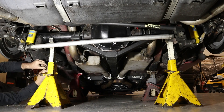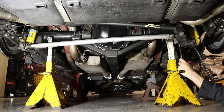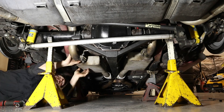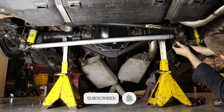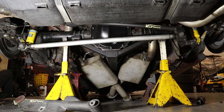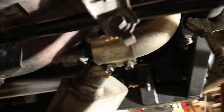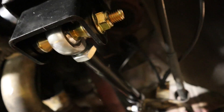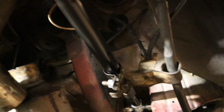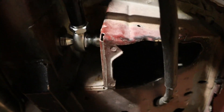I'll start by removing the lower control arms. I will lose the factory sway bar attachment points, but I've been running without a rear sway bar recently anyway and the factory location is just not good. If I need a sway bar going forward, I'll look into the Maximum Motorsports adjustable unit. Installation of the new arms is simple, but getting the new mount at the right angle took a lot of measurements and adjusting. I did need to use quite a few different shims to get the right fitment in the mounts. But here is the finished product.